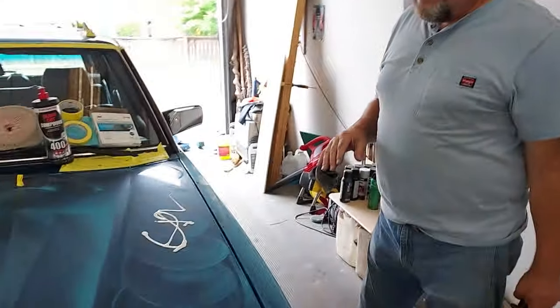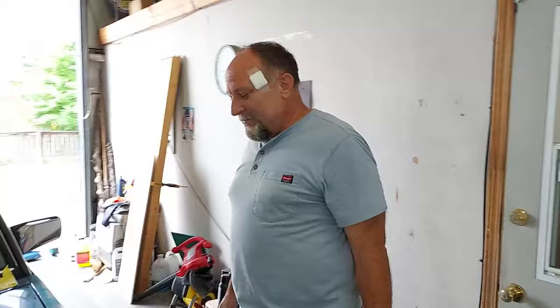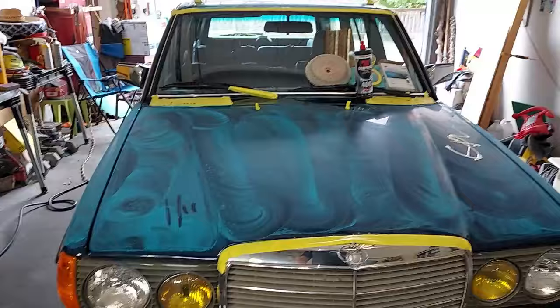After that, this vehicle had some scratches in the hood, so he had to take it down a little bit — he went down with 1000-grit dry on a low RPM, and then after that went to 3000 Trizact wet. The 3000 wet gets out a lot of the marks from the heavier paper. Since this is original paint — 40 years old and single stage — Scott loves working with single stage because you can correct it. Basically he's sanding and compounding to get scratches out of the original paint.